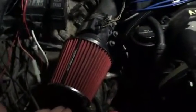You'll notice the air intake here. Normally on a 3.0 vehicle the battery is here, and it will have to get moved over. Off-Road Solutions sells a battery tray with a hold-down — it's about 80 bucks, but it pretty much bolts right in. There are a couple of holes you can either drill out or weld it however you want — it fits in there pretty well.